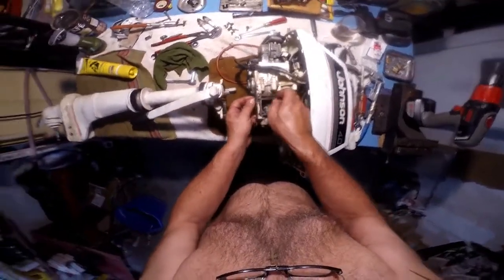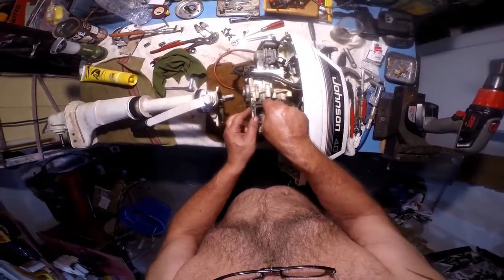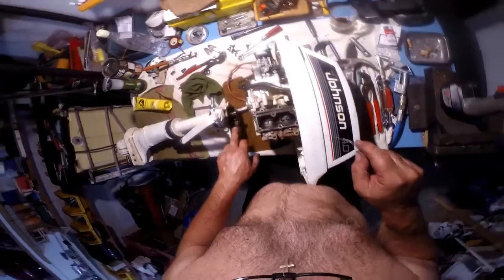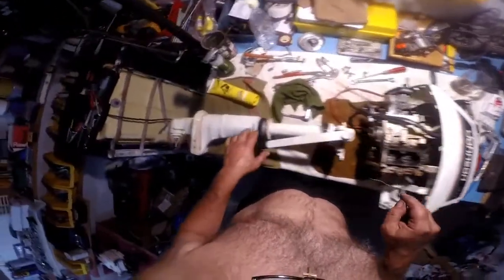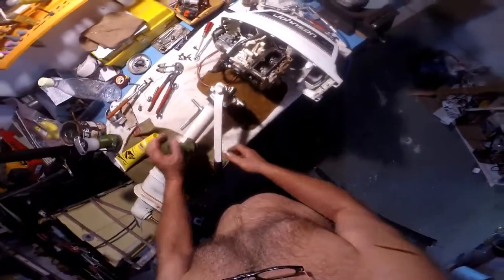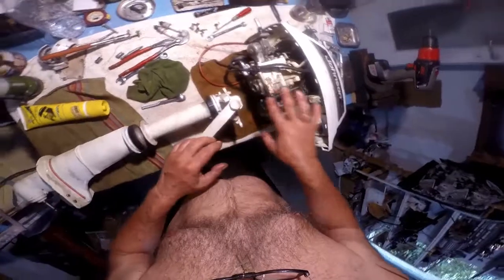See that — nice and clean. This second one here is clogged — that was the second problem. It had sand inside. I blew it out, and you can almost see how much sand was in there. That's how much sand was in there. This looks good — this is the tension area and the gasket is okay.